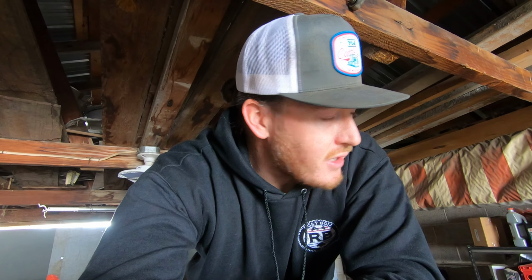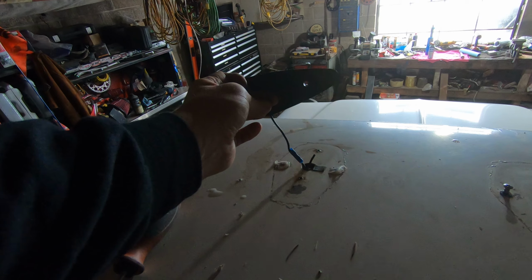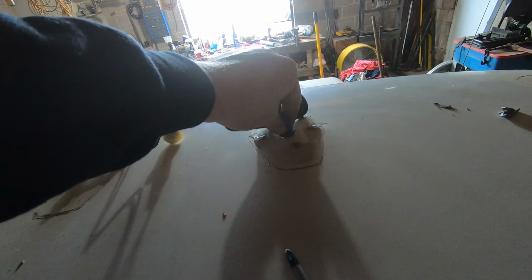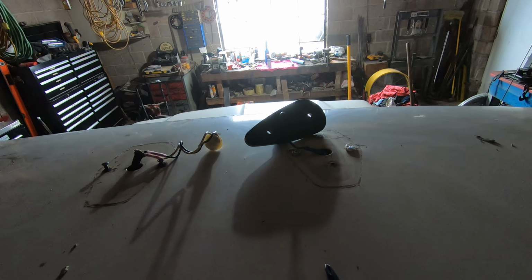But now that I have the cab light housings off, and I can see the wiring harness for it, I feel like it's gonna be pretty smooth sailing from here, because the new ones I have are just a two wire function, and so are these. But here's the weird thing. These ones, okay, are only connected to one wire, but you can see the rest of the little pigtail sticking out. I kind of got to pull them up through the roof to get to them. This one's going to be a little tough because it's so short, but there are wires already on the new ones.